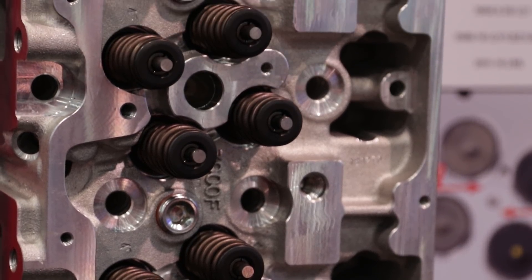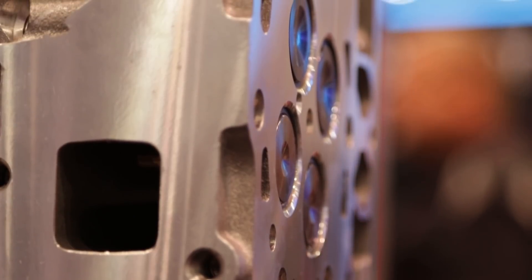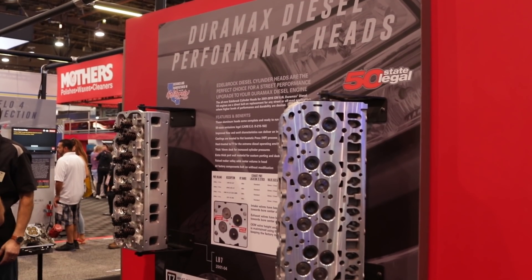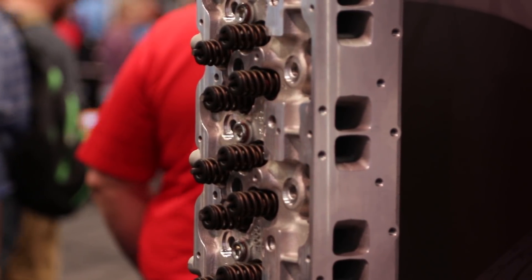What is the true advantage to the gentleman out there building a Duramax? What is that advantage of all that process — the T7 and the HIP — to the owner of this new cylinder head? A guy who's got a bone stock Duramax and needs a replacement head, we've got a solution for him. It's 50-state smog legal. We just got our CARB calibration from the state of California, so it's a direct bolt-on. All his stock accessories go back on — all his rocker gear, valve covers, you name it. Even the early LB7 motors had that integrated injector cup that would back out and leak. We've gotten rid of that. We have a machined-in cup with an O-ring seal. Our one casting covers all four generations of the Duramax engine — we just machine it accordingly.